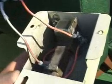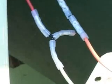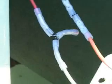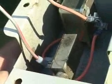So in a Bluebird, at the back door, to install the diode sniffer on the red and black wire. The red and black wire comes out of the back of the bus, comes into a first diode, out of the first diode, into the second diode, out of the second diode, and into the switch.